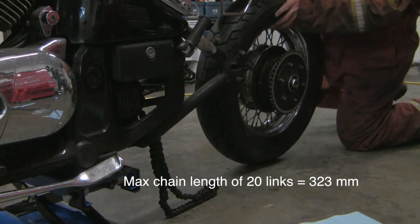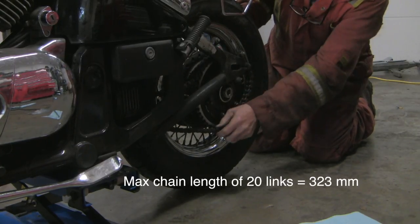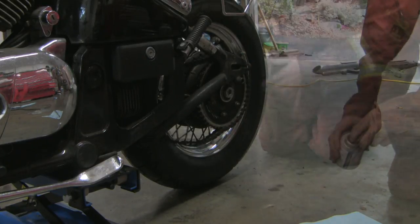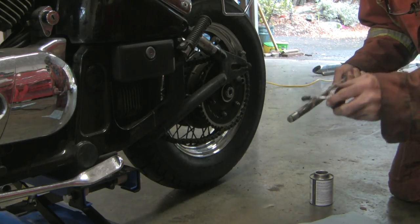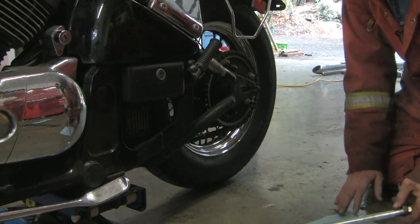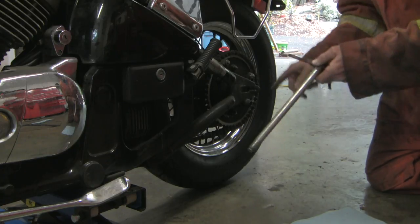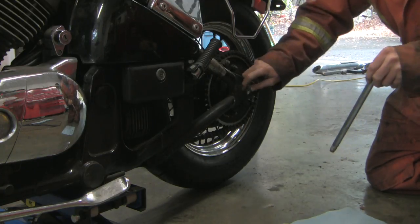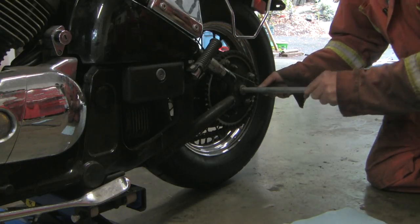I've had a close look at the chain and it seems to be fine. I'm putting a thin film of silicone grease on this shaft just to let it go in a little bit easier. One of the great things about having a motorcycle lift is you can adjust the height up and down. Now this is a second take because I messed this part up - this little flange needs to go into here before you can get it right, and you can't put it in afterwards. So you slide it in like that first. Don't do what I did.